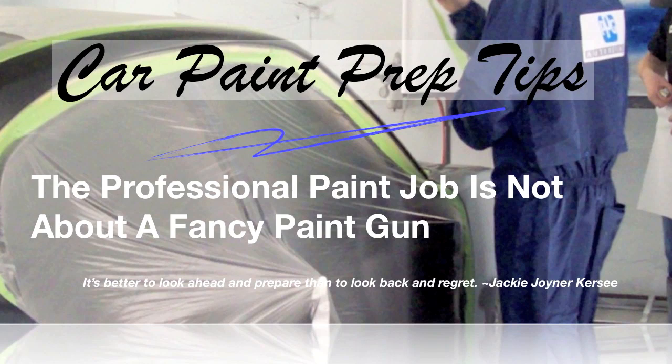That kind of puts it in perspective: the prepping has to be done right in order for the spraying to be right. If you prep the car well and then someone talented sprays it, it's going to look awesome. Cleaning is so important. You're going to clean before you start working and sanding, and you're going to wash before you paint after all the sanding is done. Prepping is a lot of washing, so don't skip that step.